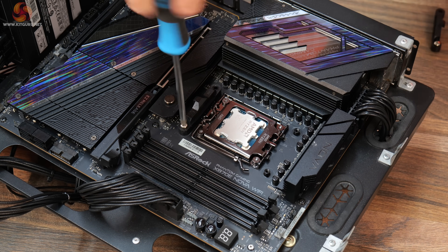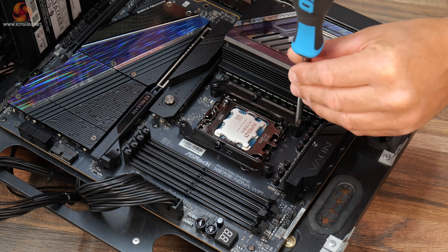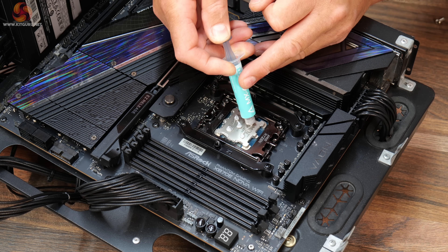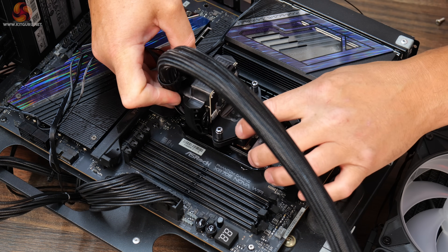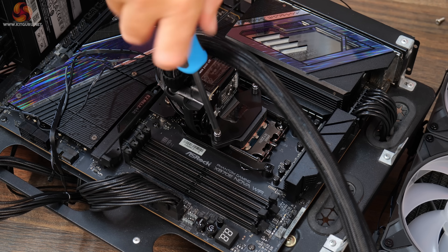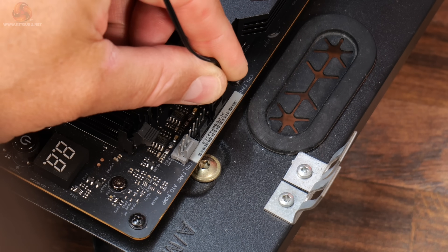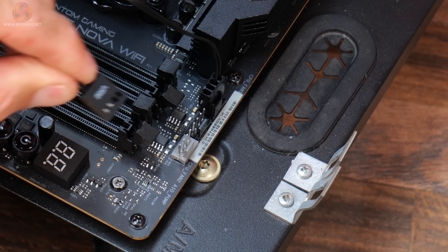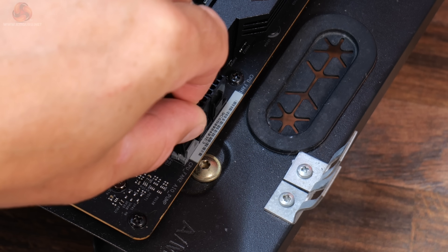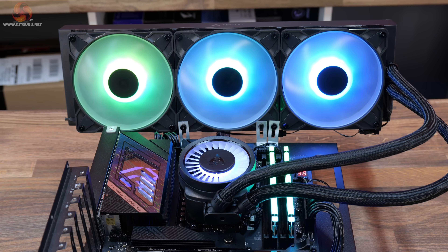I'm using the multi-cable for independent speed control. Remove the stock AMD plastic upper mounting brackets from the motherboard, then place the four AM5 plastic spacers over the back plate mounting points and fasten the upper CPU block retaining brackets to the back plate using the provided screws. Apply some Arctic MX6 thermal compound using your preferred method. Lower the CPU block into position over the CPU, align with the two mounting points on the brackets, and tighten the two retaining screws evenly and progressively to apply even pressure on the leaf spring for optimal CPU contact. Remove the protective label, place the top cover in position, connect the fan cable to a PWM fan header (usually labeled CPU_FAN), the pump cable to an AIO pump header, the VRM fan cable to a PWM header, and the three-pin ARGB cable to a 5V ARGB header. That's the installation complete.